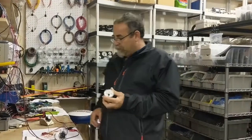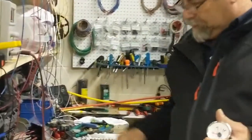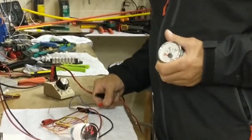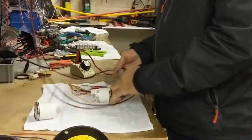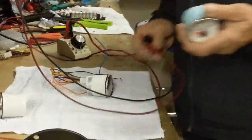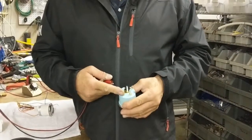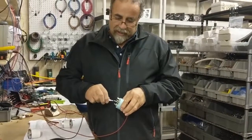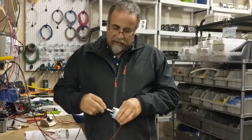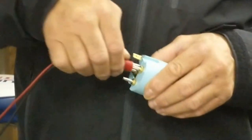It's very simple. If we take this gauge over here and we have 12 volt, for example, and this is my 12 volt over here. Now, any gauge in the world has three different terminals in the back of it. The first one they call ground, so we are going to attach a ground over here into the back of the gauge. Then it has something that says I, which is for ignition. So we have I for ignition. Now this gauge is ready to go.